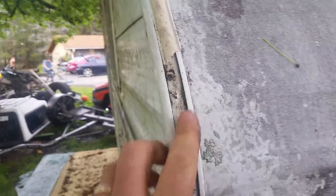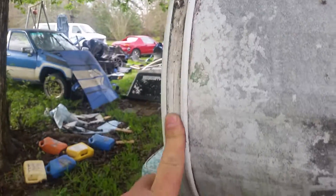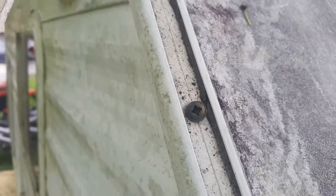They'll staple this tin into the wood and then put this corner molding on with a layer of sealant tape underneath on the underside, form it around and screw it. But as you can see — I'll show you — see how crooked that is? That's a factory screw. It's like they worked from the side and put it in at an angle.